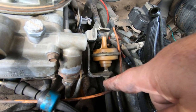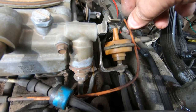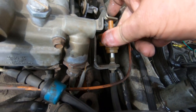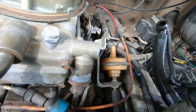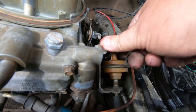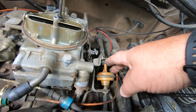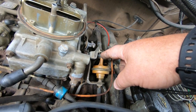The black lines tee here and go into your throttle kicker right here. If you don't know what a throttle kicker is — if you put a load on the vehicle like turning your air conditioning on, the vacuum will pull this and open your throttle up a little bit so you maintain RPMs. The throttle kicker was not working — the bracket was bent way down with about an inch gap.